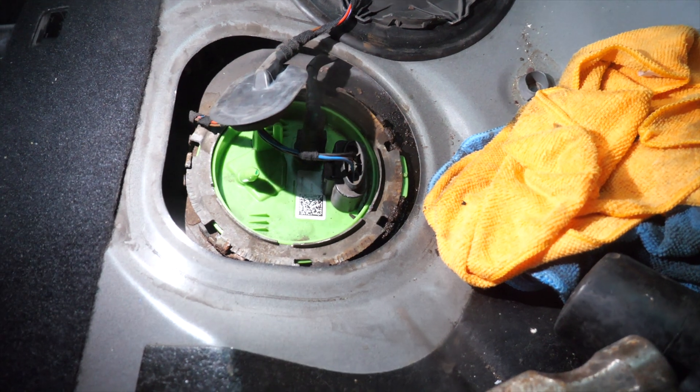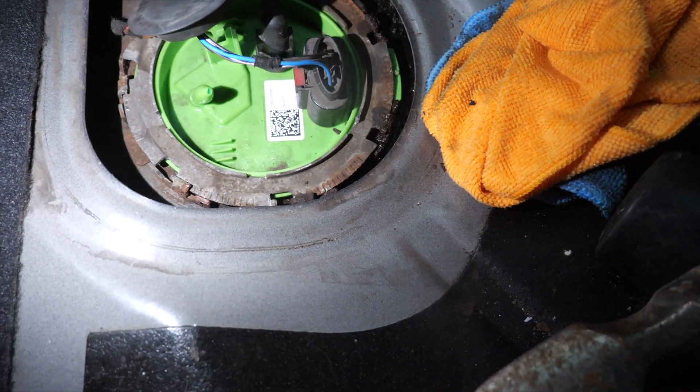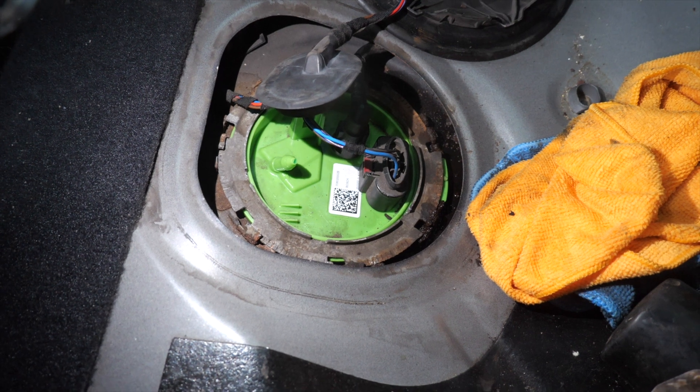It's priming for some reason - that's a bit weird. So you've got the holes - line up the tab and then hit the inside bit with a hammer to lock it into place. There are little locking rings that lock it all in. Start it up - there we go, you can hear it priming. We should have cleaned it up before fitting the new one. It threw up a little mist, we turned it off and back on and it's gone - that was just air in the system with no fuel in the pump. No fault code, so if yours does that, just turn it off and on again.